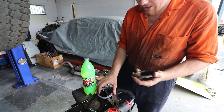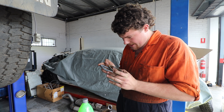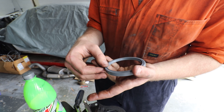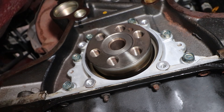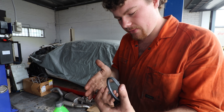It's pretty much an engine for you, or anything - complex moving parts, all it takes is one thing to fail. These are a double lip seal, so the outer lip is to stop dust, water, and whatever else from getting in. The auto bell housing is definitely cleaner than a manual one to start with, but the dust seal keeps everything out from this, which is your main oil seal. The lip that faces inwards sits against the oil pressure.